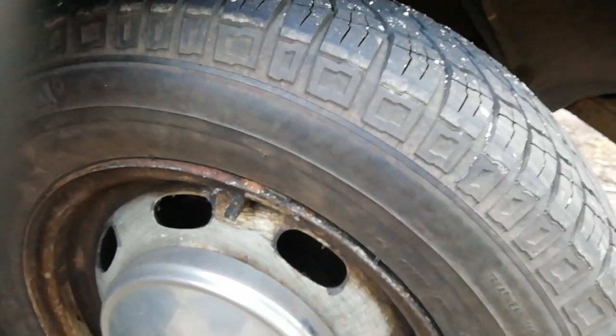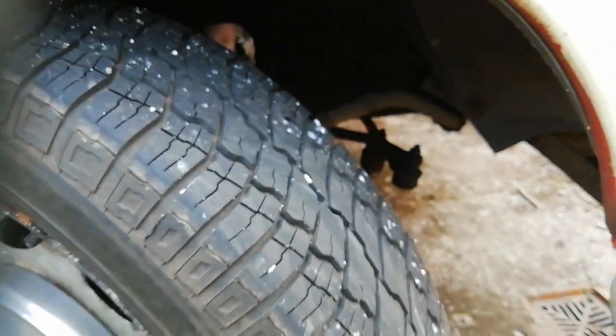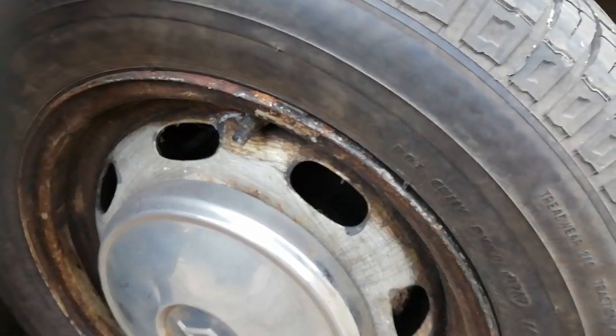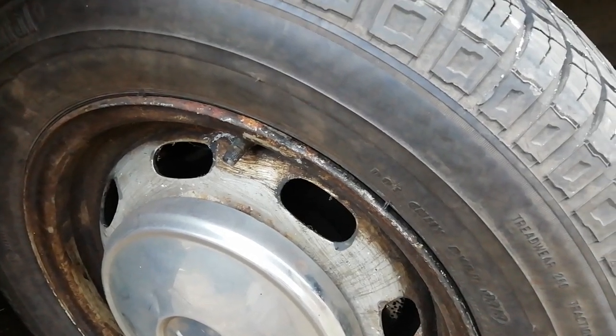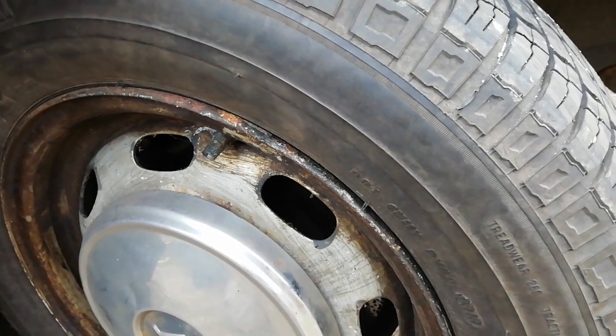Wheels and tyres, Amazons. The ones I tend to use these days are the original 165/15s, but if I possibly can, I try to put them on the 4.5 inch wide estate rims. Seems to get good handling and light steering as well. I've never really gone for the super wide ones. I think they just cause you too much bother.